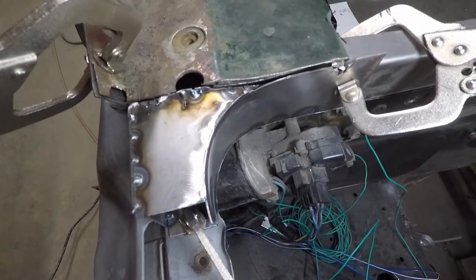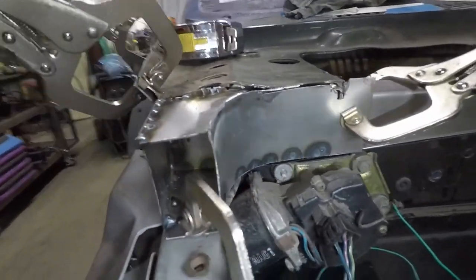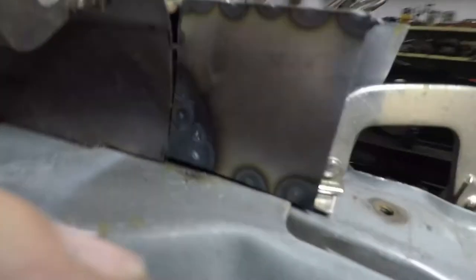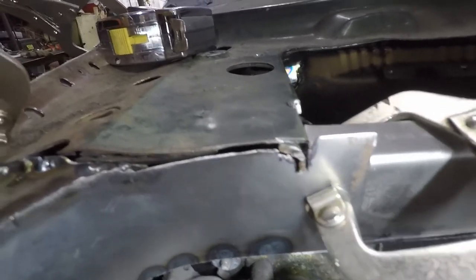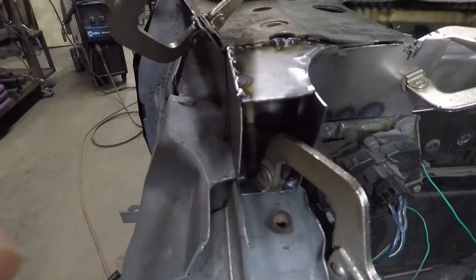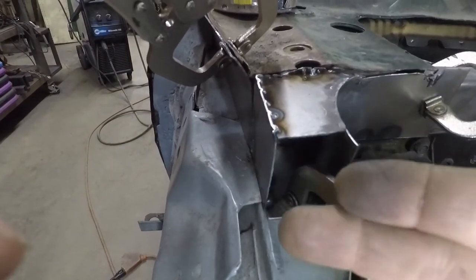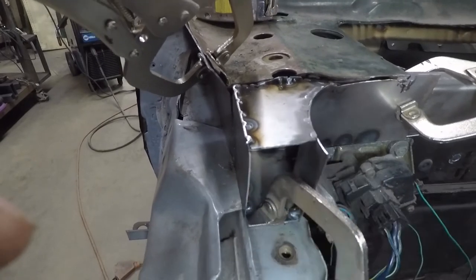Now we've got the passenger side all mocked up. I'll fill in that hole there, and the top is capped off — both sides capped off. We can weld there on that joint and weld it down here. It's tight to the bottom, feather that in there, and it all fits along here. We'll tap that in and weld it to make a nice round joint. I'm pretty happy with that concept. I'll probably run this bottom plate up and cap this off to give something to weld to and add more strength.